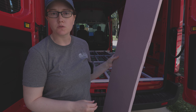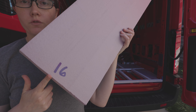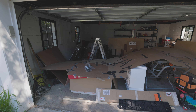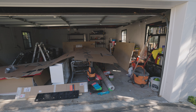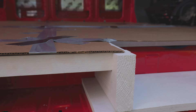I'm going to take all of the XPS foam that sits on the outer edges of the van, put it in, and then we can bring our cardboard template back out to test the fit. We numbered all of the foam pieces so it's as simple as just plugging them in, because all of the ribs are slightly different. The cardboard template has been living in the garage for the past week — it's huge — so we're a little worried it may have shifted. We'll put it back in to check before we trace anything onto our nice birch plywood. We did have a little bit of shifting, so we're going to do a little bit of trimming to make it perfect before we trace it onto our plywood.